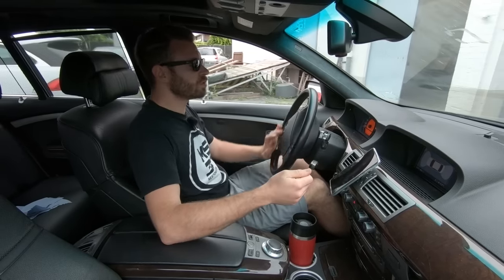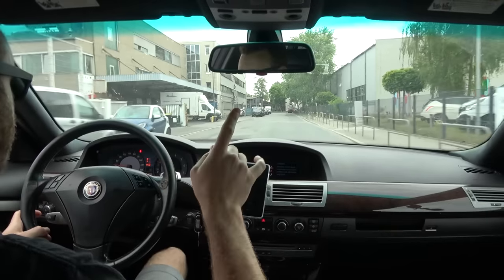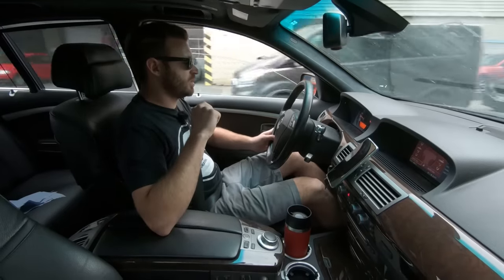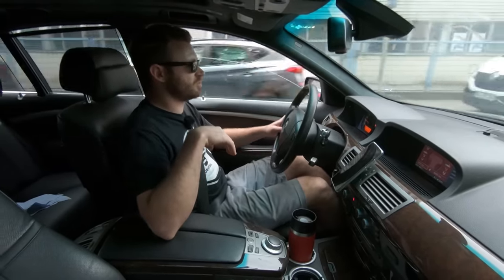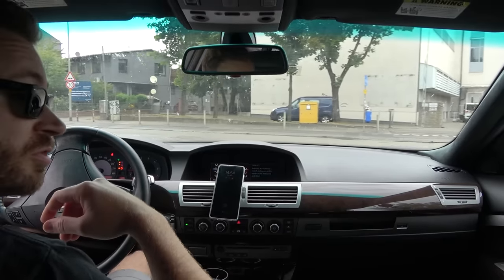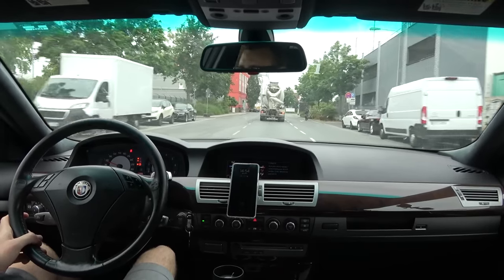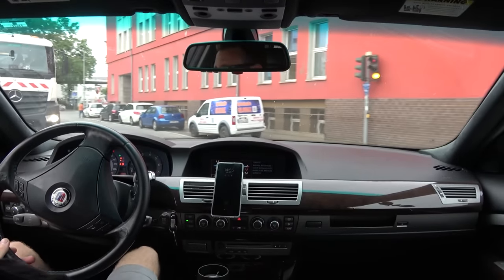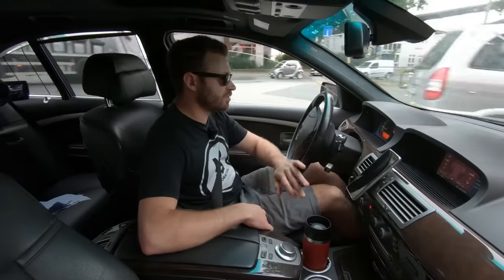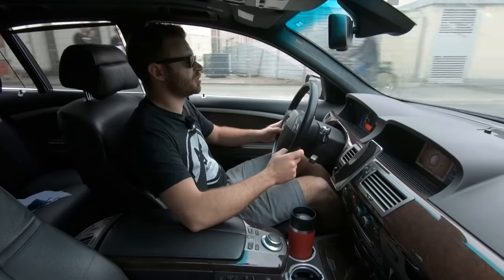Here's how we're going to drive: up to 4,000 RPM with moderate acceleration, just keep the revs going - not too hard. We're going to aim for around 150-200 kilometers and then come back and change the oil. If everything is still okay, go and drive a bit more. No radio, no AC. We are at 206,703 kilometers - I reset the board computer, so it's going to count how many kilometers we do.